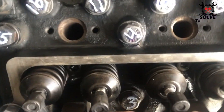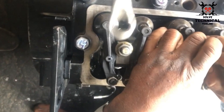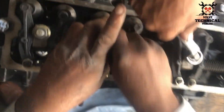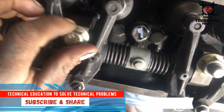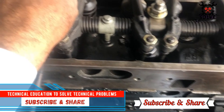When you are tightening the nuts of the rocker arm or rocker shaft, make sure that your tappets, your push rods, and your rocker arms are making a proper sequence for the valve movement.